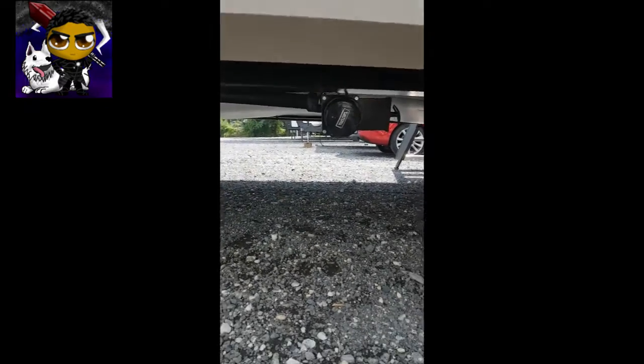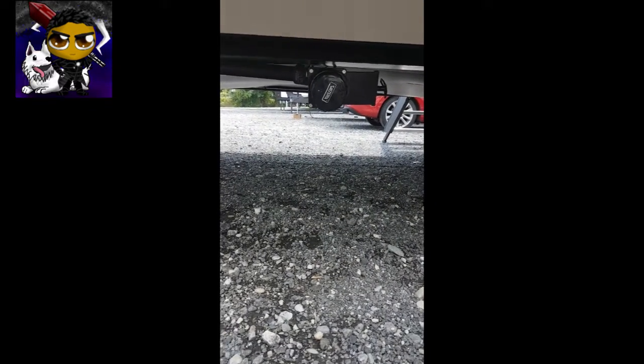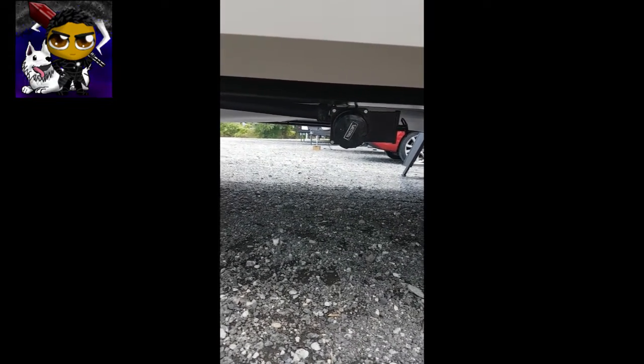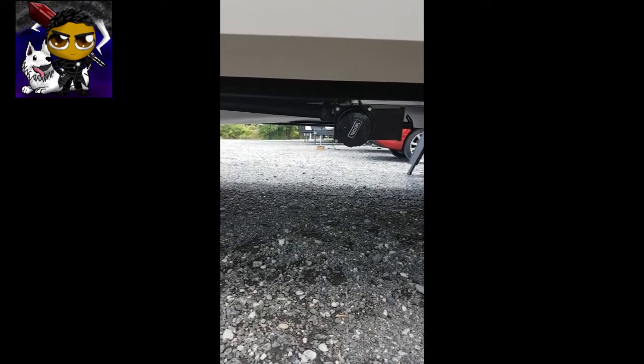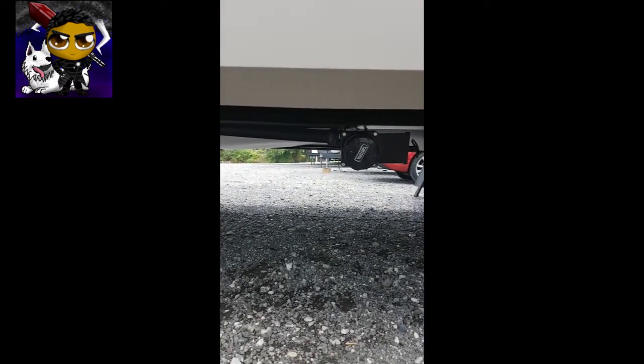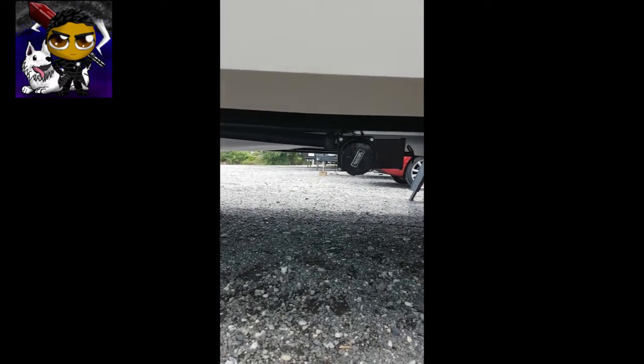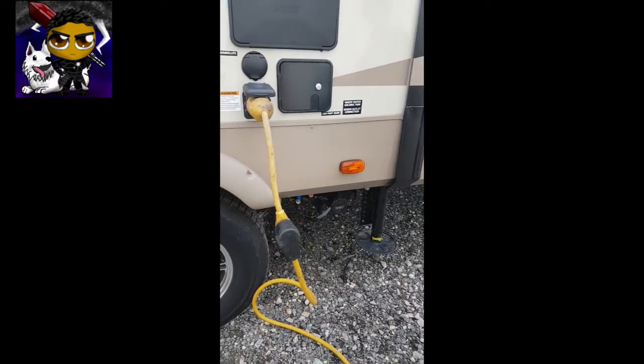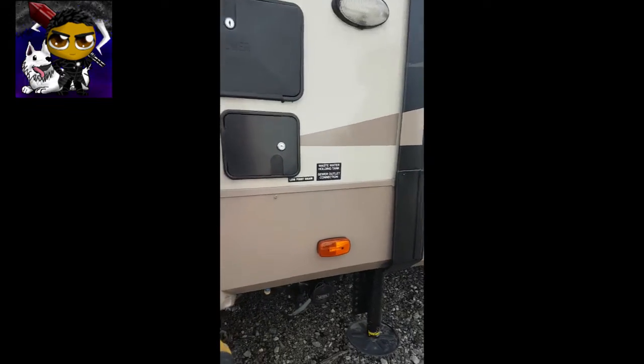So you have a galley tank, which is kitchen. Okay. And basically all you gotta do is get your sewer hose, hook it up, and just pull the lever. Okay. And inside you have a monitor panel, and that lets you know your levels of everything, like how much water you have in your fresh tank, how charged up is your battery, your sewer. Nice, I got black stuff all over. Yeah, how much your black tank is full and whatnot. Galley tank. Gray and black tank is, and that's shower water. Sink water is gray, and then black tank, of course, is going to be like toilet waste and whatnot.